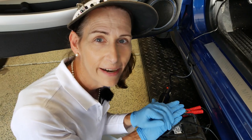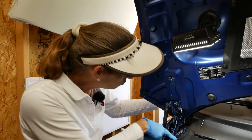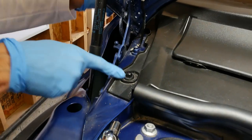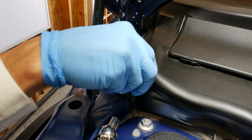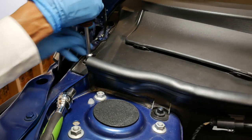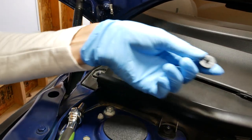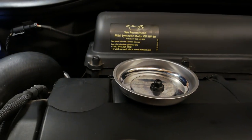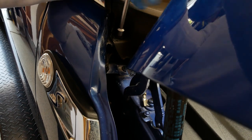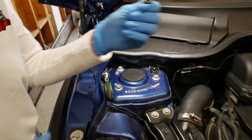To remove the cover — which we need to remove to get the battery out — there are two 10-millimeter bolts, one here and one back here. One is plastic and the one in the back is metal, but both are 10 millimeter. We'll also pull up the rubber stripping to be able to pull the whole panel out. I always like to have a tray to put things in so we don't lose anything.